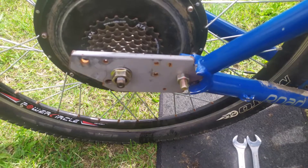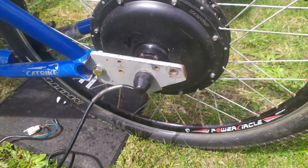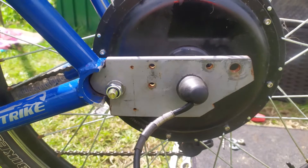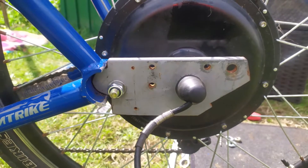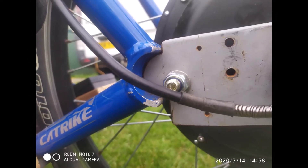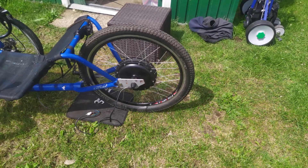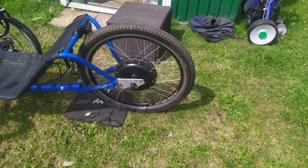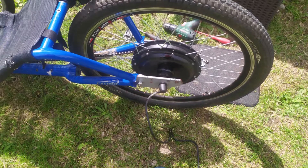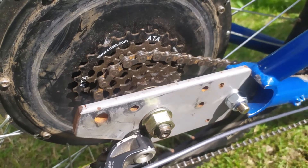So what I'm going to do is build a bracket which will extend the frame so I can actually mount the wheel onto the trike. My aim is to make the bracket in such a way that it doesn't have to be drilled or fixed to the frame at all, because I don't want to weaken the frame. What I've done is cut the metal so it snugly fits into that egg-shaped cup there, and the bolt goes into where the original wheel was bolted.